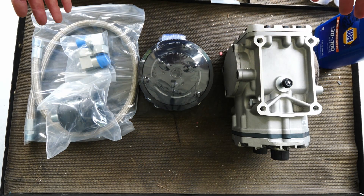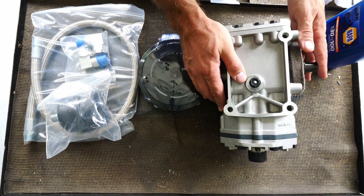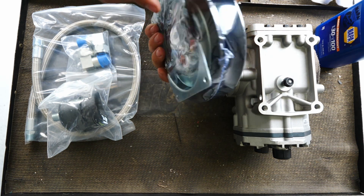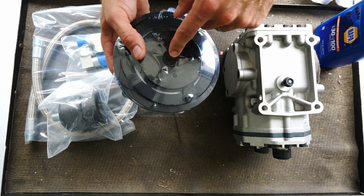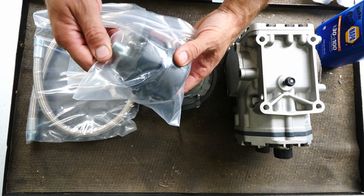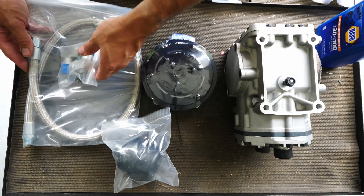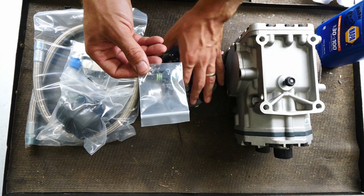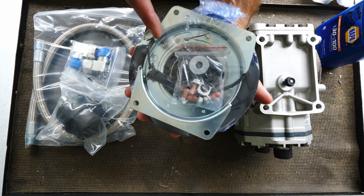Assembly of the compressor is pretty much straightforward. You have your York compressor with a snout on the end that the electromagnetic clutch slides onto. It's got a mounting bracket that bolts to the case of the compressor, and then a bolt that goes down the front into the shaft. The kit also comes with an air filter, a stainless discharge hose, the fittings that go on the compressor, and a single wire weather pack connector to match the one pre-installed on the clutch.